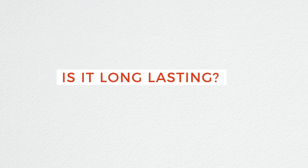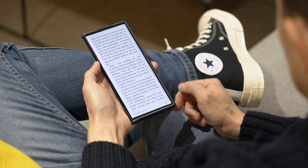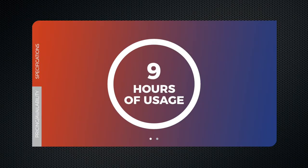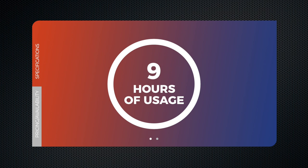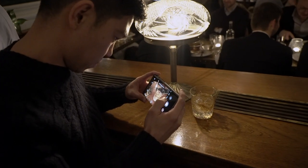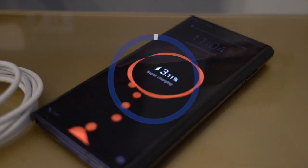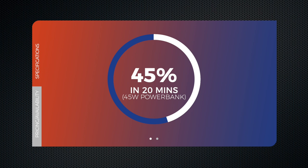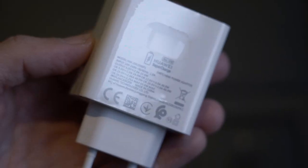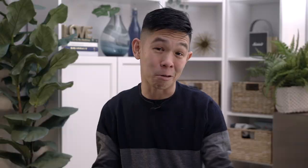Here are some questions about the phone's battery life. Is it long-lasting? How long did it take to fill it up? How big is the battery? I'm happy to report battery life is actually pretty good. Considering I used the phone heavily, at the end of my first full day the phone lasted about nine hours of real heavy use — including a 40-minute phone call with my airline, tethering, plenty of photo-taking, and social media. Screen-on-time was over five hours. Charging was fast too. On the go, it only took 20 minutes to get to 45% using my 45-watt Huawei Supercharged Powerbank. Using the bundled 55-watt charger, I got to 63% in the same 20 minutes, 83% in 30 minutes, and a full charge in 54 minutes.